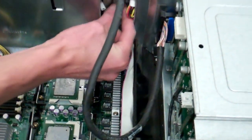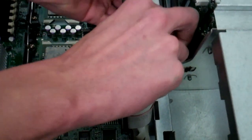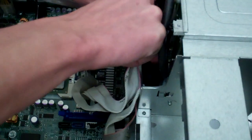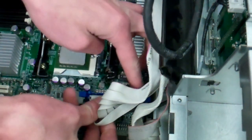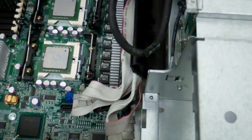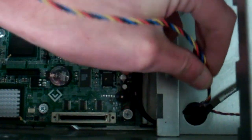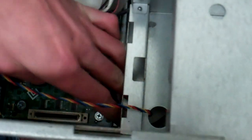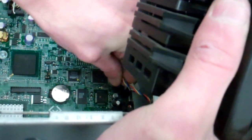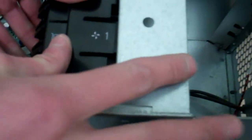Got that in there. Tuck cables up here — this one's for our CD-ROM drive. Push it into the cable management. Spread the socket open; you'll notice the notch — straight down. Now put the front fan back in. Fish the cable through the hole down here — it helps to have small hands. Pull as you go, then connect it. There are two tabs and two holes — push it down, tilt back, and click.